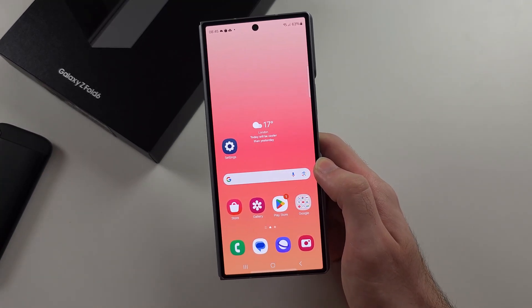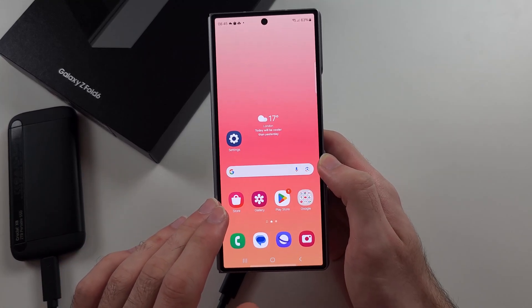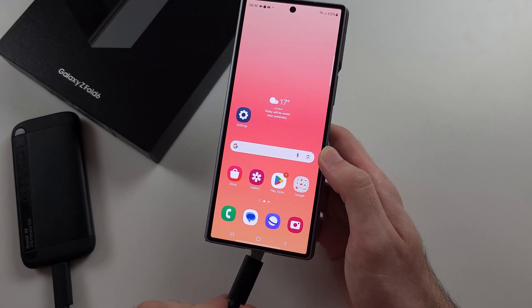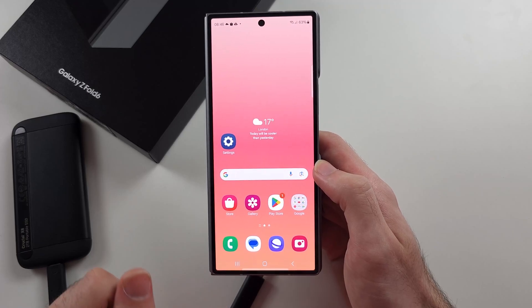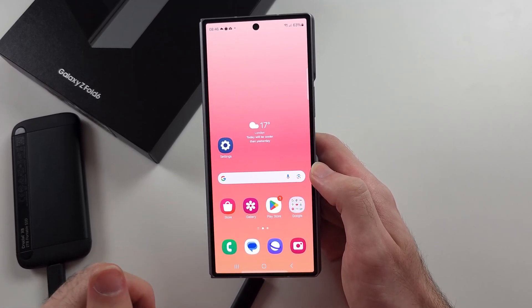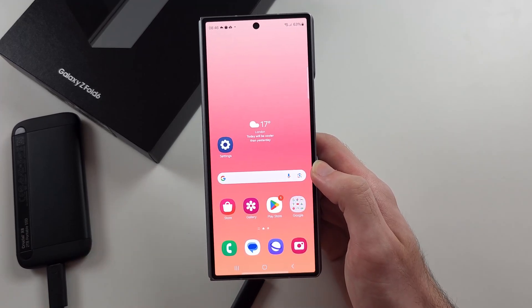Typically that's going to help the problem, but please note that over time there is a hardware fault with Samsung phones — literally all phones — where there will be a point where you connect your OTG and it just refuses to work properly with that connect and disconnect issue. So if you have it, I'm sorry, there is literally nothing I can do. I did try and research a solution, and the restart is the only thing that I found that helped.